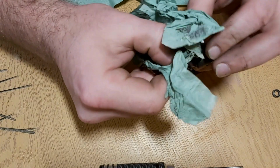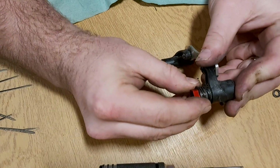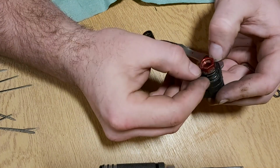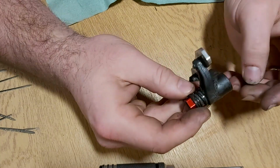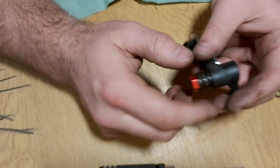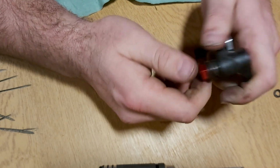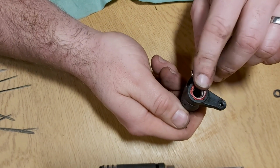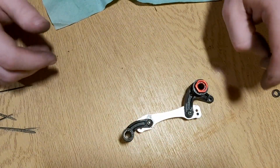And what I've come across online is simply getting some circlips over the top of that and underneath behind that washer and pushing the spring down that way. So that's what I'm going to try and do today. To get these apart, they're full of Loctite, and from what I hear, every time someone tries to get them apart, you end up damaging the plastics. You would have to grip hold of that, get a socket onto there, and turn, because you can't get a socket on the other end because that's in the way. So let me grab the circlips and I'll show you what to do.